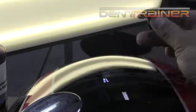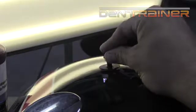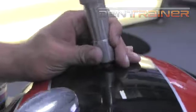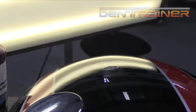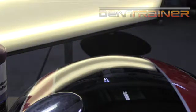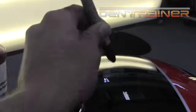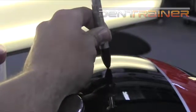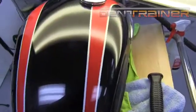Got a little low back there on that back end, and that was from just knocking down that peak. It just took metal with it. You've got a strong peak line, and when you start to knock it down, that thing may be stronger than the metal around it, and it's going to take some prisoners with it. It's going to take a nice little surrounding group of metal. As you can see here, we were able to pull that little group of metal right on up. Created a little high spot there. Now it's up to me with my hammer and knockdown to just lay it into the surrounding finish. Always doing knockdown work.